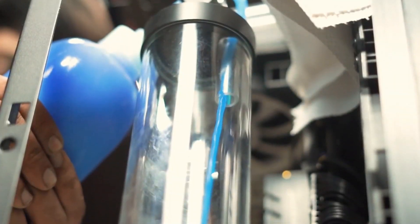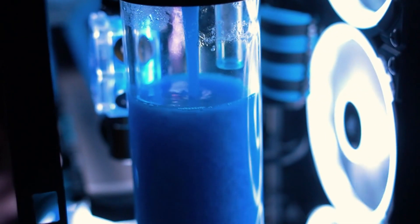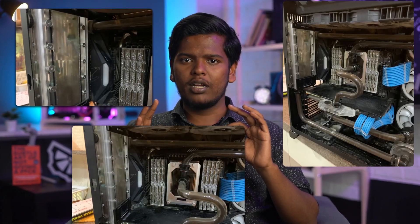There is one last thing you should know: maintenance. You will have to regularly keep changing your coolant because there are a lot of things that can go wrong if you don't — the worst of it being fungus. Yeah, you heard me right. Although this is not the most likely case, it can definitely happen. One of our clients didn't maintain his liquid cooling system for two years and his liquid turned out black in color. So it's important that you take care of all of this when planning a liquid cooling PC.